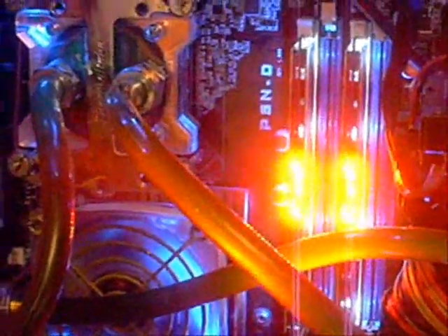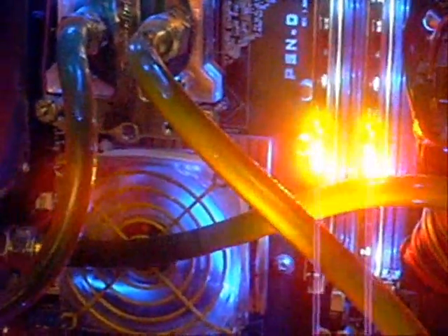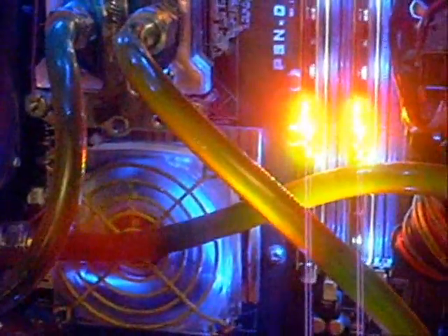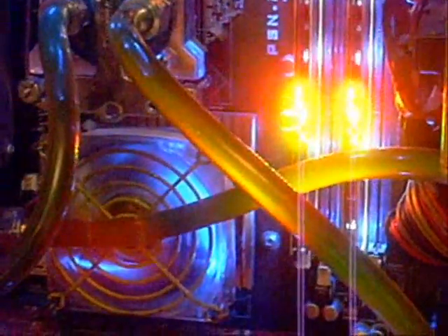With the flashing lights, it really adds a nice effect. So many times we see products that claim to be something great but very few actually live up to their hype. In this case, this particular product isn't one that's all show and no go — it's real high-quality RAM. It's not just for the blinking lights. You're getting 4-4-4-12 timing on it, and it's very overclockable. This is an 800 MHz RAM and I've seen people push them to 1050 or 1100 MHz. So it's good quality RAM, good for overclocking, plus you get the added bling with the flashing LEDs.